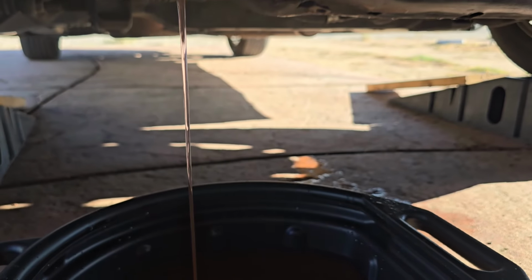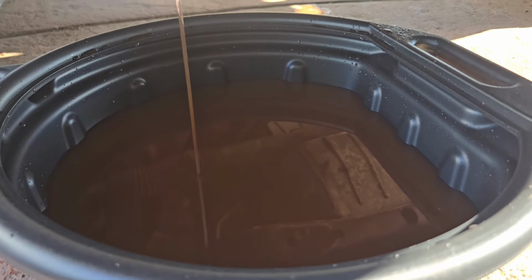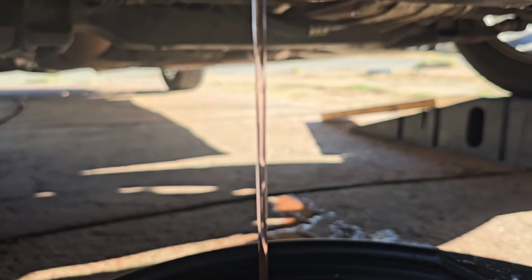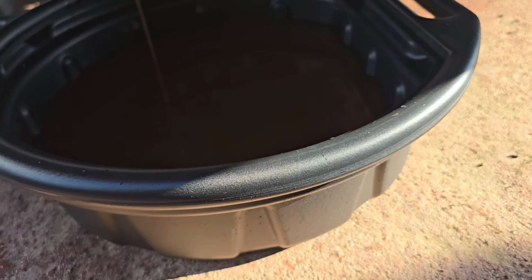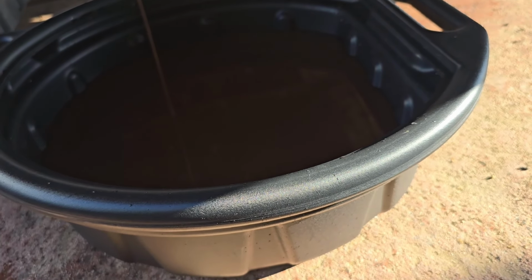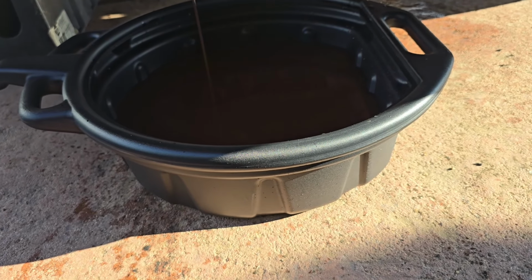Yep, see all that old coolant? That's not water, that's more coolant coming out. And that's why you run distilled water through, because although it was done draining before, once you put that water in there, it's gonna help flush out that old coolant. And as you can see, that's exactly what it's doing. That is pink water. Some old pink lemonade. I mean, it's orange. So it looks like they had the right stuff in there, because like I said, it's supposed to be the gold color, but over time, it's gonna get discolored due to all the heat cycles. So it looks like they had the right stuff in there, just not enough of it. And I don't want to take the chance of putting the right stuff in there and then it'd be different from what they had in there.